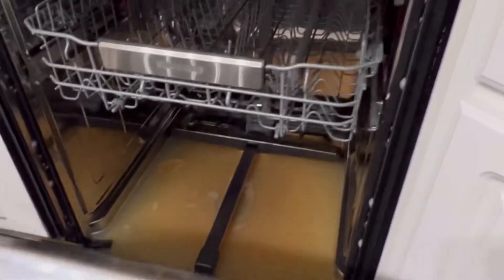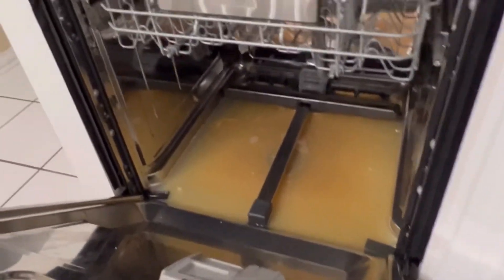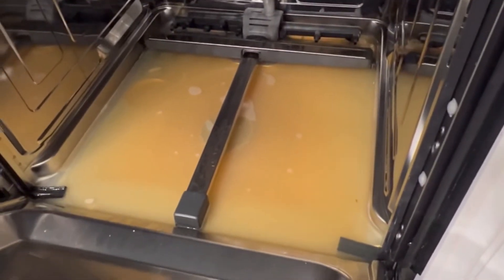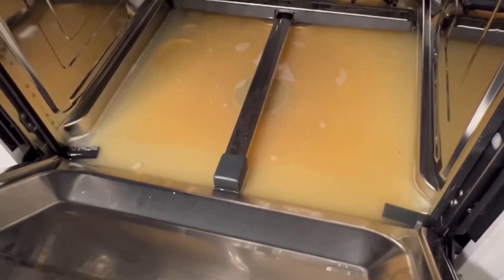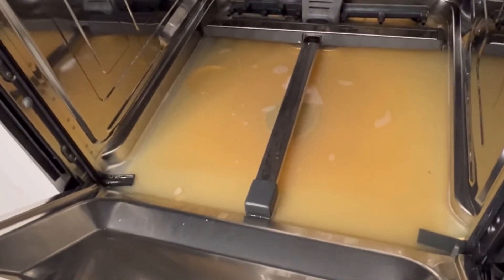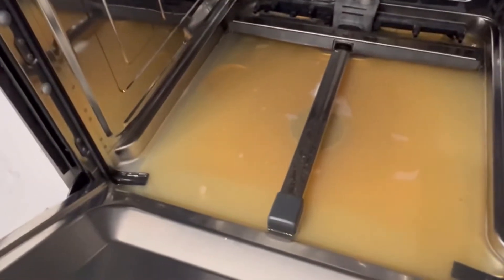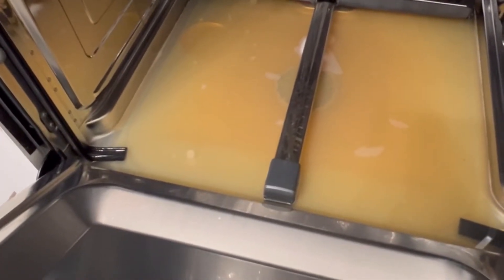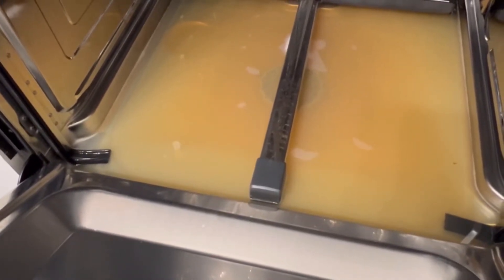This is my brand new Samsung dishwasher. The first time I ran it, it clogged up. It wasn't this bad — I found some debris in the drain hose, took it out, thought maybe that was the problem. Just ran it a second time and this happened again, and it actually had an LC code this time. So I'm going to drain it again, pull it out, and check the complete drain line. It's brand new — literally only the second time it's been run.